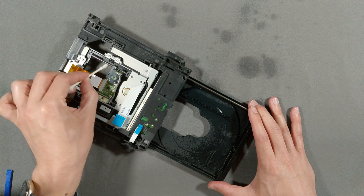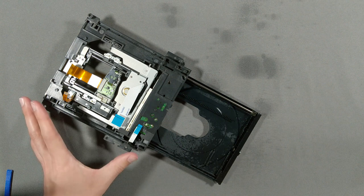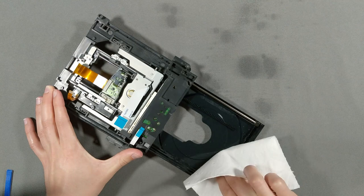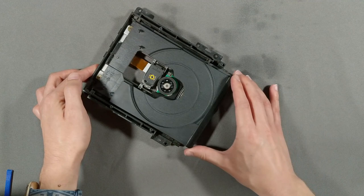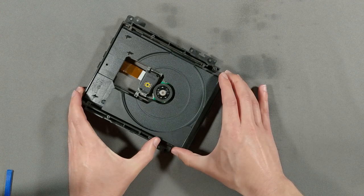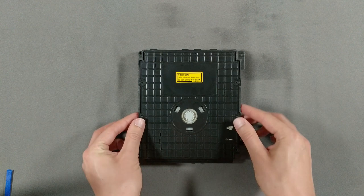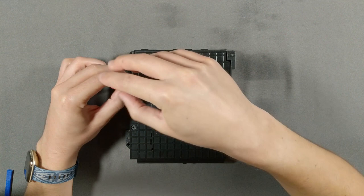It's a little like buying genuine GBA games on eBay. White lithium grease is another popular option, and I haven't seen a definitive case for one lubricant over the other. This gives me a good opportunity to show you how to clean up any additional lubricant you may have applied in error — just add rubbing alcohol to a soft cloth and wipe it away gently. After lubricating the parts, I exercise the drive tray a few times to work it in. It already feels much smoother than before, and it doesn't get stuck all the way open or closed like it used to. Before you put the top back on the drive, make sure that the tray is able to close fully and the laser carriage is returned to its horizontal position. It's easy to jump a few teeth on the drive tray and get those parts out of sync, preventing them from operating properly once the console's back together.